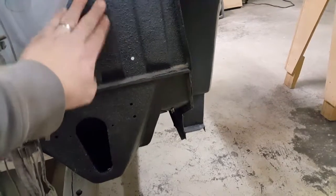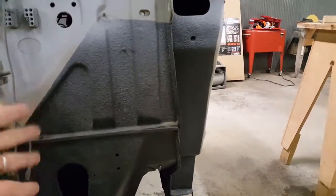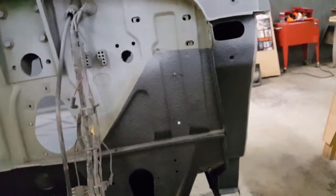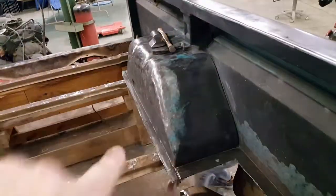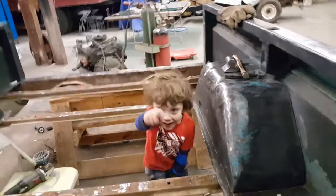Once we fixed that, we sprayed an over-the-counter bed liner material — it's a U-Pole Raptor liner, got it on Amazon. It was a bit over $100 for 4 liters and included the spray gun. I've used three of them, doing the entire bottom of the cab, up the front inside, and the inner fenders. They're over there primed and bed-linered on one side, ready to get chassis black painted. We've got one liter left and we'll probably do the inside of the wheel wells on the bed with that — it'll do both sides and the inside of the fender, and I'm considering doing the metal at the back end behind the wheel wells because it gets a lot of dirt thrown up into it.